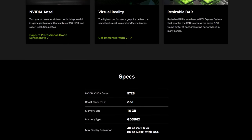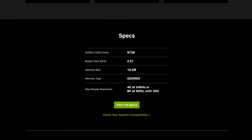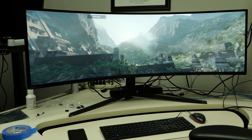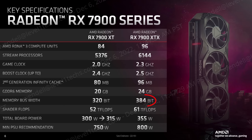When their competitors launched their next-to-highest tier GPU, I was kind of surprised by their memory selection, given that people with those cards are rocking 4K or even ultra-wide like the Samsung G9, which is 5K resolution. It's a 384-bit memory interface bus, 61 teraflops on the highest-end card, 355 watts for the 7900 XTX versus 300 to 315 total board power for the 7900 XT. It'll work with an 800-watt power supply — 750 watts recommended for the 7900 XT and 800 watts for the 7900 XTX.